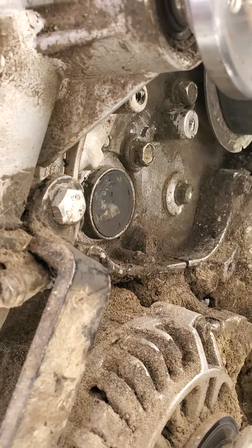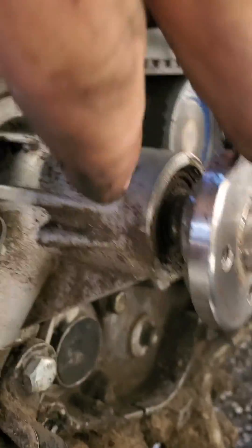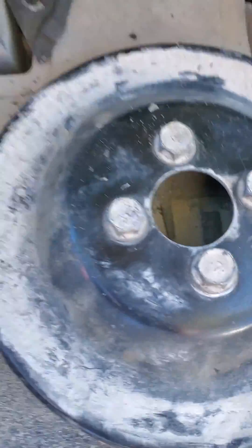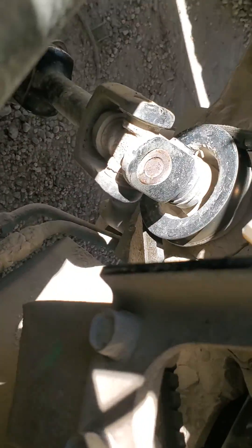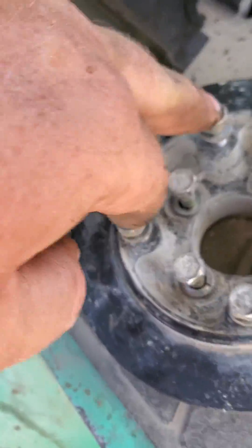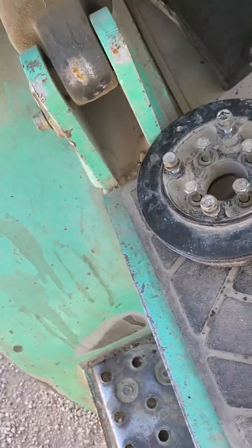You have to get it around then twist that to tighten it up on the back side, then put it on there. The water pump pulley comes off with four 10mm bolts right there. This one has a drive shaft — the type of shaft that goes over and drives the fan — and that was four 12mm bolts, then four 12mm bolts to hold the balancer.